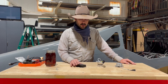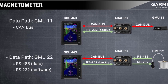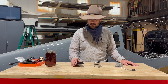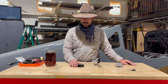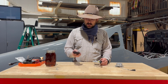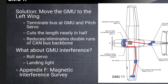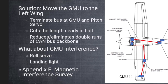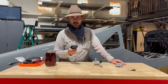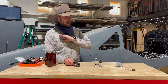That's the last time I'll mention performance — that's not the point of this, and it wasn't Garmin's point either. That's just the flavor that came out on the internet. The real difference between these magnetometers is how they communicate. The GMU 11 and GMU 22 are the two you'll hear most people talking about. The GMU 11 is designed to communicate on a Controller Area Network — a CAN bus. The GMU 22 and 44 do not. That's the biggest difference.